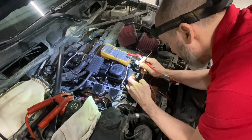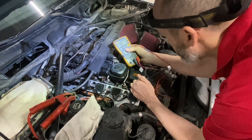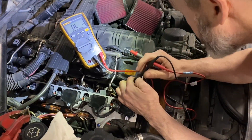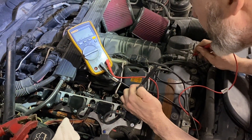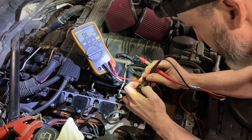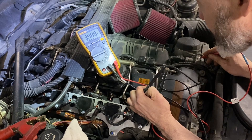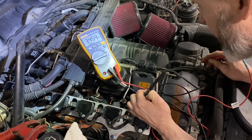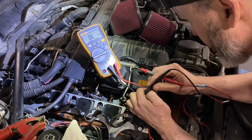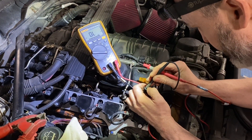It's not really a very good test this, it's a bit basic, but I'm just checking a known good cylinder resistance value. So first of all checking to ground - let's get that positioned so we can see it. It's a good little test. First one: three ohms roughly. Second one is usually a really weird mega ohm value and it discharges - that's okay, 3.4, you'll see it starts to drop down. Nothing wrong with that. And we can also check continuity to ground.